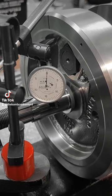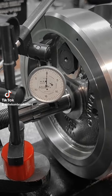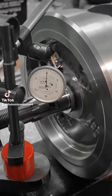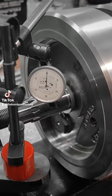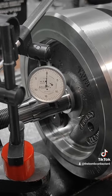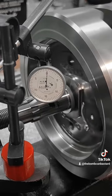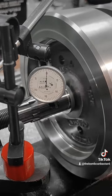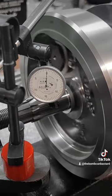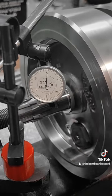I like to use the crank pin as a zero point and then adjust from there, whether it's tight or loose, measuring high or low. It's also important to note what graduation your indicators are using. The indicators I use when building flywheels here are five ten-thousandths — meaning each line is 0.0005 instead of the one-thousandth that a lot of people are used to seeing. So in this instance, that's just barely moving — we're talking maybe up to two ten-thousandths of an inch, depending on how you read the indicator. That's really what we're looking for in these assemblies.